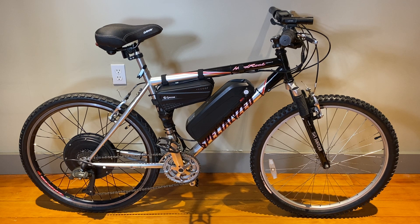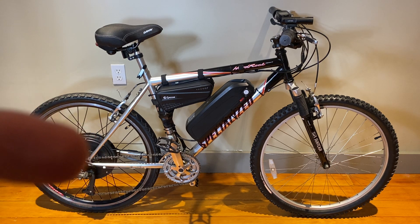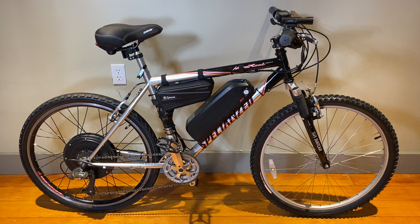The first thing is I'm using the AW 1000 watt 48 volt 26 inch wheel. It's on the back there. It doesn't quite fit this particular bike — when you put it in, there's the cog (not the cassette but where the sprockets are in the back), and those little leads were rubbing. So I had to install some washers in there.